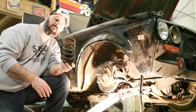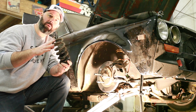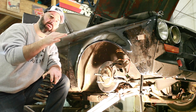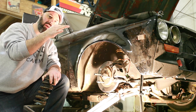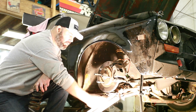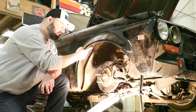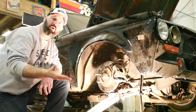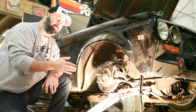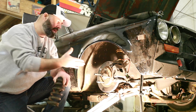Step one to stroking the suspension was to remove the springs so we can move the suspension without any resistance. We put a zip tie around the shock shaft, and as it compresses and comes back down, the zip tie stays at the point it's been pushed to. We measure that change in distance on the shock shaft versus the change in distance from the bottom of the rotor to the ground, which gives us wheel movement. Based on our math we think it's around a 0.97 motion ratio, so we'll see how close we get with this method.